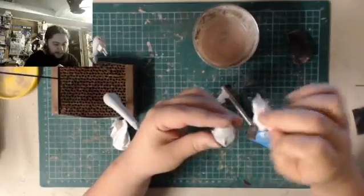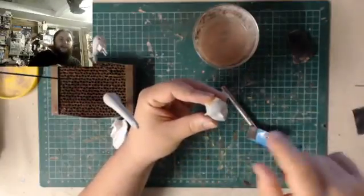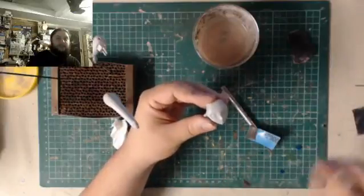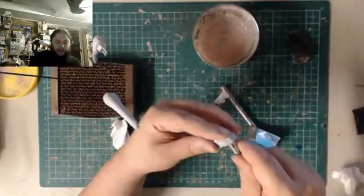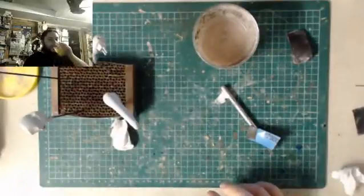And also, if you're doing a gloss surface and you do a wet coat of paint and a few coats of gloss, and then you give it a 2000 grit, maybe go further and polish it and sand it with higher grit, you can get a beautiful, nice, deep sheen finish as long as the preparation is all there.